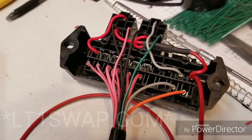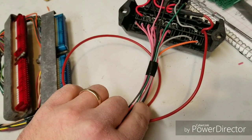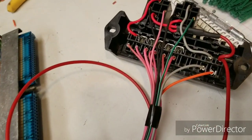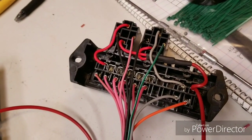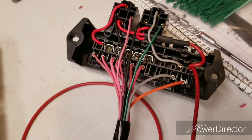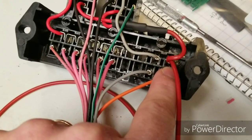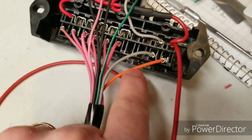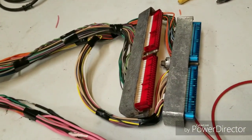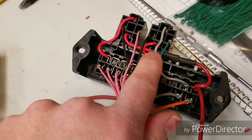Here's how I do it. This big red wire is going to be the main power feed from the truck — it's a 12-volt constant and it's fairly heavy gauge because it's going to be feeding everything: the fuel pump relay and the relay that runs all the sensors such as the oxygen sensors and the injectors. This 12-volt constant goes into this fuse pin location, then straight through a fuse and out through this orange wire, which goes to the PCM and runs the PCM 12-volt constant.